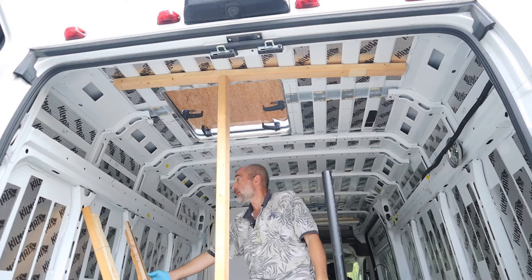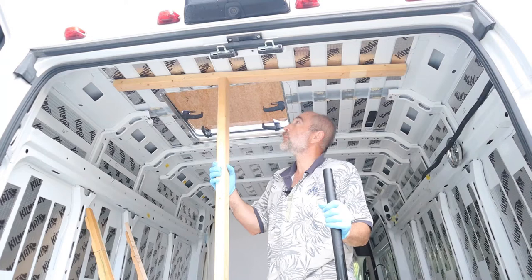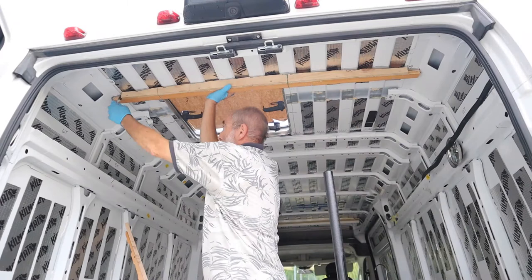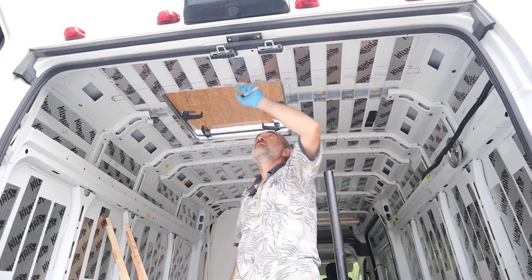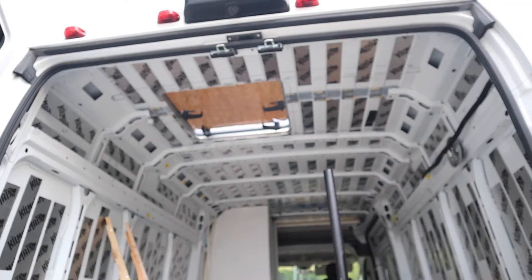And that's what I'm going to do right now. First I'm going to take this down because that is going to hold this piece up. I drew that sharpie line because I need to rough up the paint — I'm going to use 40-grit sandpaper and rough that up so that it will adhere better with the construction adhesive.